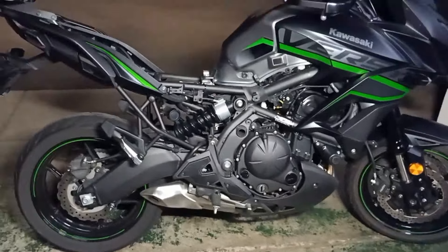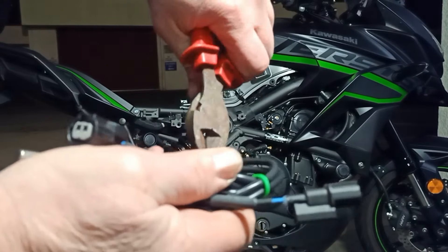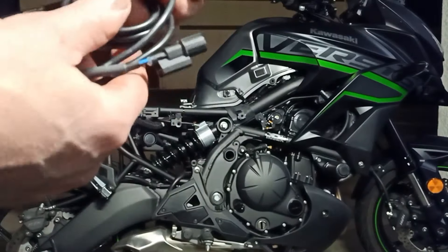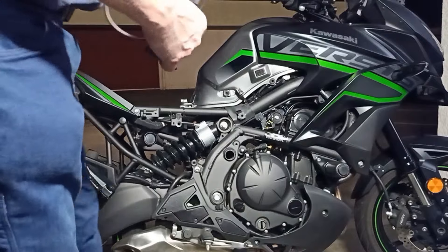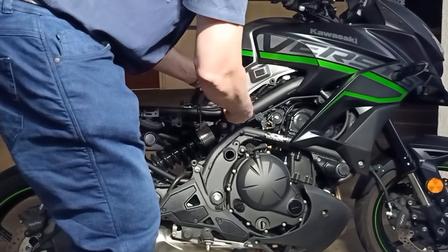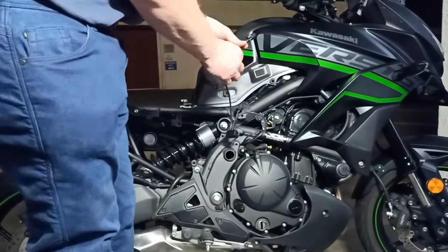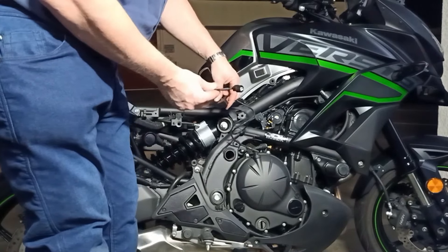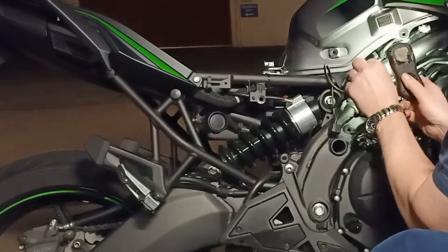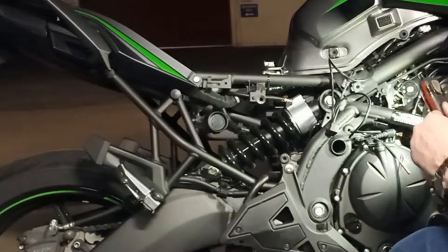Now we just have to fit the booster plug in-line. We'll carefully remove those cable ties. We've got a male and a female connector here — that just clicked in there perfectly. This end now has to go into the plug on the airbox up the top. We'll get it started and push it in until we hear a click.